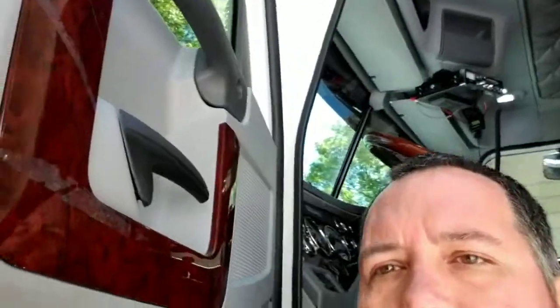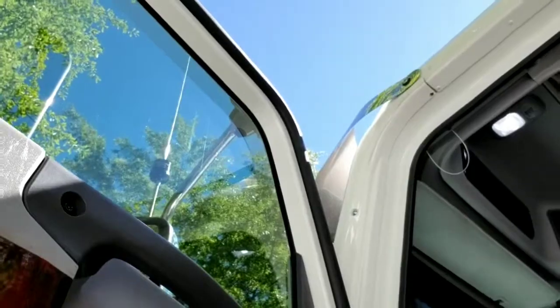The best thing Freightliner ever did on this truck, I do believe, is ground the mirror to the body, or to the door. So that's a good thing. I'm not having to fight grounding issues as far as getting the antennas grounded good. And I am using a Wilson 2000 antenna. Just one Wilson 2000 antenna, one coax. Very simple. It's a lot less complicated than Freightliner's approach on doing coax and radio antennas, I guess, with the stupid box and all that stuff that never works good anyways.